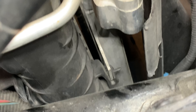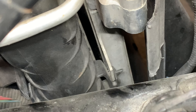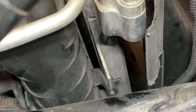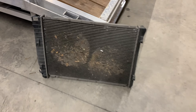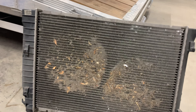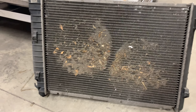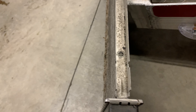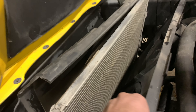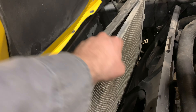Since this is still somewhat of a street car, you also want to lift the AC condenser off of the radiator — that should be the last thing holding it in. This is what a lot of years of driving and 123,000 miles will do to a radiator, and that probably didn't help at all. As you can see, this radiator is really thin. We got it out with the fan — you just pull the fan up, push down, pull this up, push it down, unhook everything, but it works.